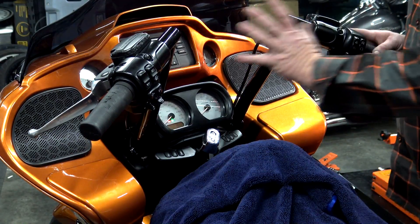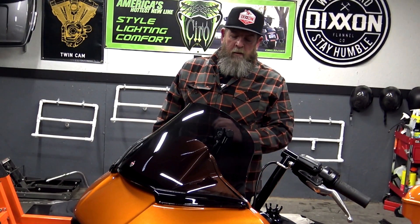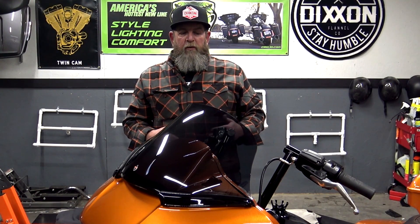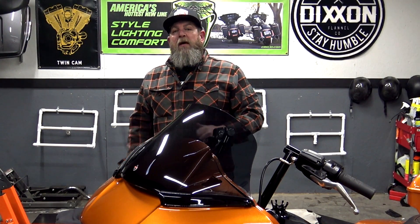Run the two screws back in the sides. Once you have your ignition back on, go through all of your controls and thumb controls to make sure everything works. That gets rid of the stock lay-in-your-lap handlebars Harley-Davidson sends us and leaves us with a really nice set of custom bars on the Road Glide. There are a ton of videos on Road Glide handlebar swaps — they're pretty easy to change. With 13-inch bars on this bike, no cable or wire extensions needed; just do the little tricks we showed inside and the wires fit. Road Six Customs makes these in different sizes and different styles — link is in the description. Drop any comments or questions in the comment box below.